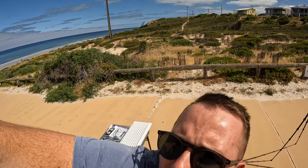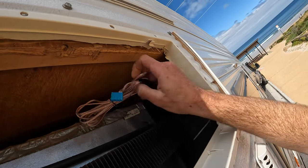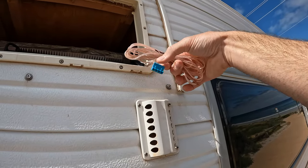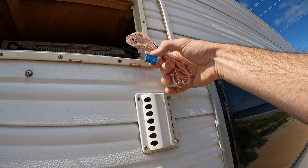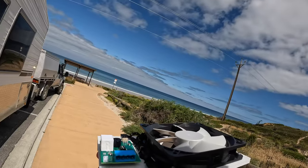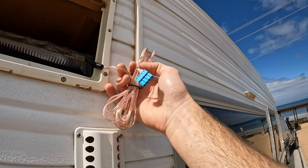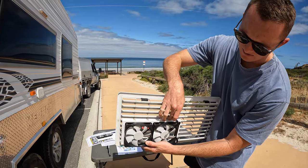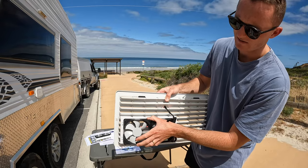You can see the size of these fans compared to the tiny 70mm fans that are already in there - it's going to be a worthy improvement. The cable is supplied by Clever Cool with a little connection that hooks into the board - blue goes to blue, pretty simple. All you need is a constant positive and negative, which is what this wire is, and then it clips into your board. You can see the notches and everything perfectly sit there - it sits quite nicely and snugly.